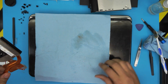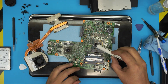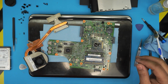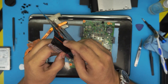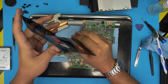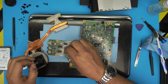Put the four screws back on the fan. Once done, we're almost set. Grab the motherboard and bring it into position. Apply one drop of thermal paste on the big die and one drop on the secondary die. For the GPU, we need a thermal pad. We're going to use Thermal Grizzly pads — 0.5 millimeters. Grab the pre-cut pieces and place one pad right on the GPU.